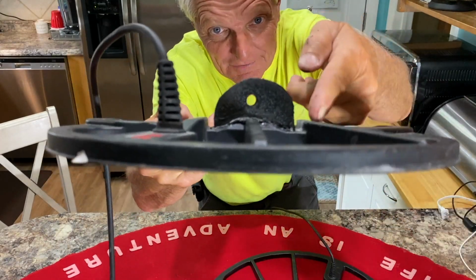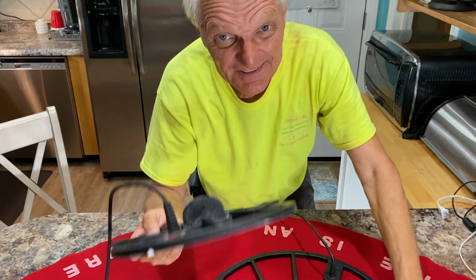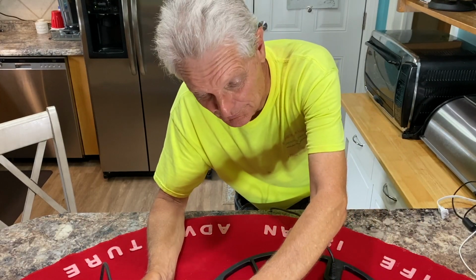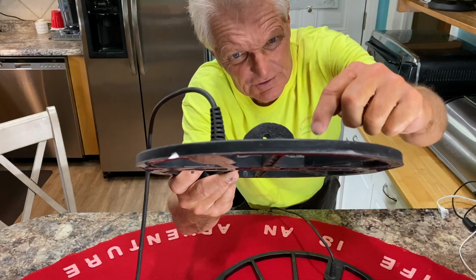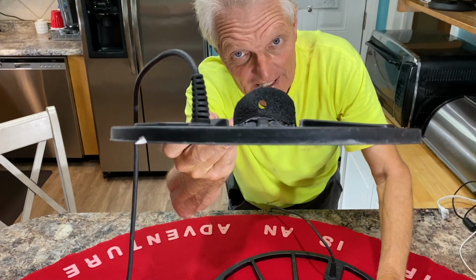All right, everybody, we are done with the coil repair process. As y'all can see, I made the little piece up here. Now, I tell you one modification you notice, it doesn't come all the way over here. My friend El Marty, I listen to y'all when y'all talk. He mentioned, you know, if you go all the way, you're going to create like a little cup in there and it will collect sand and water. He's right. So what I ended up doing is not going all the way to the edge. So you got drain holes on all four sides right there.